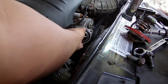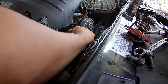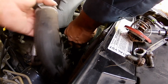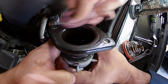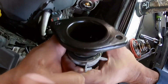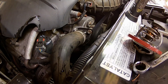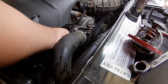Make sure that's seated all the way down correctly. Feel around the edges and make sure it's all even. Check in the thermostat housing to make sure there's no old gasket material on there — if there is, clean it off before you put the new one on. Start the top bolt by hand, then start the bottom one by hand. Don't tighten the top one yet because you need to be able to move the thermostat housing around a little bit to get the bolts to line up correctly.